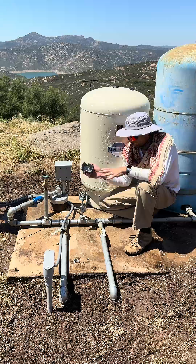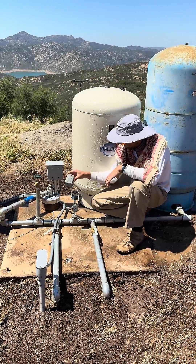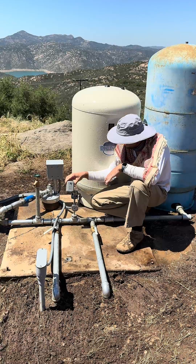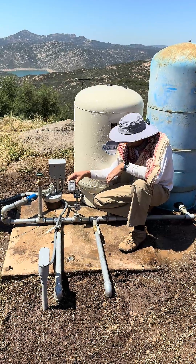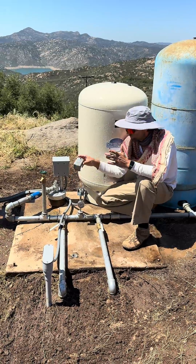If you don't have an electrical meter to test with, you can use a plastic lid. All you do with the plastic lid is flip it in there. You'll hear the pump starting, and that's how you clear out the pressure switch.